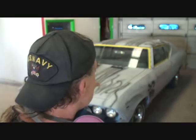So, back to what I was trying to tell you in the beginning, I am at the stage now to block sand this down. Now, to get the proper show quality finish, you have to wet sand it. You can dry sand it using 180 grit, which is basically equivalent to the 400, but we're going to go 400 because it gives it that more glass, slick finish. We aren't going to have any deep scratches that might be caused from the dust building up on the sandpaper and this, that, and the other.